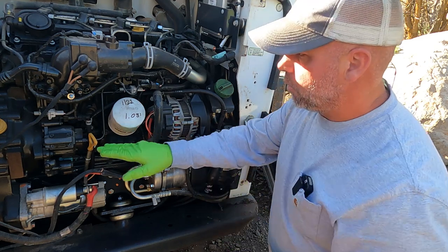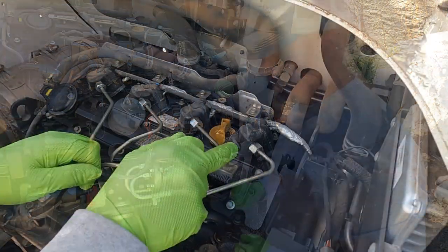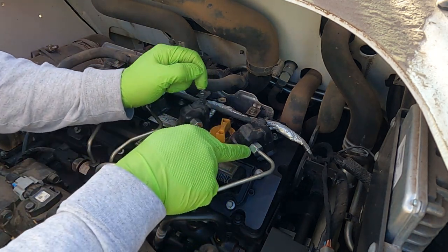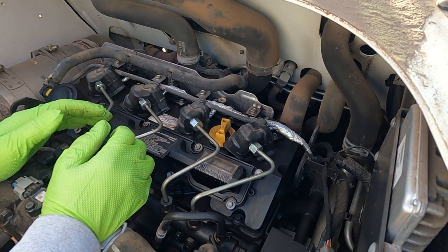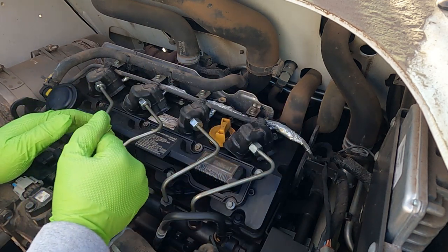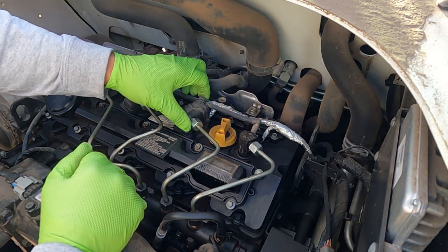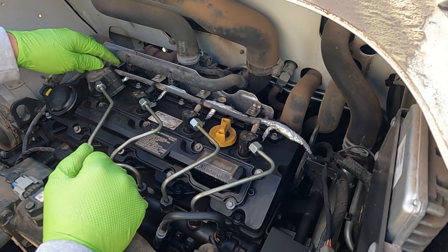So I know I've got fuel to the injection pump and I don't suspect the IMV — I'm going to go straight to injectors. What's concerning is I can see these boots are already removed, and on these fuel injection lines somebody's already had a wrench on these. It's almost like they're trying to bleed the injectors. Common rail diesel engines — you do not crack these lines, you do not bleed the injectors. They will take care of themselves as far as air is concerned. But somebody's already been in here and they may have caused more damage than good.